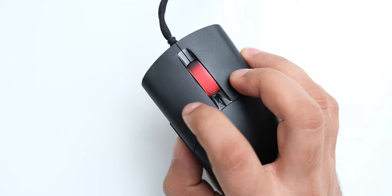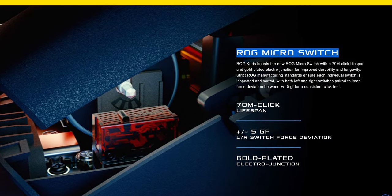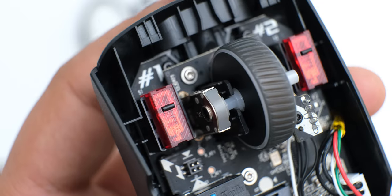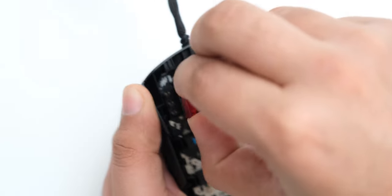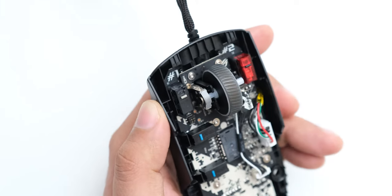The primary buttons feel very nice and clicky with extremely low travel. ASUS is using their own ROG microswitch instead of Omron ones, which I think is a better choice. These are rated at 70 million activations, though actual durability can vary. Impressively, ASUS's push-fit switch socket design lets you replace the switches without any soldering — and you even get two extra Omron switches in the box. Double clicking is a very common microswitch problem, so this easily replaceable switch feature adds a lot of value and extends the mouse's life significantly.